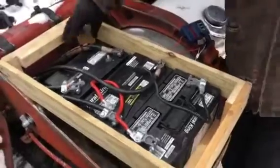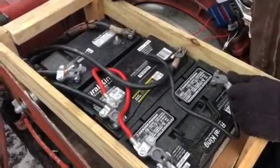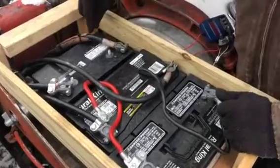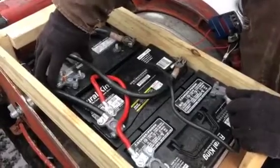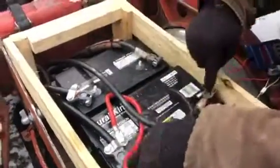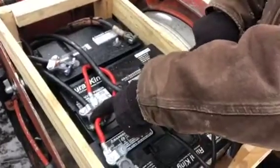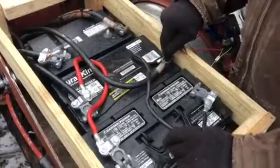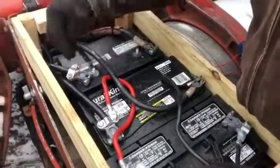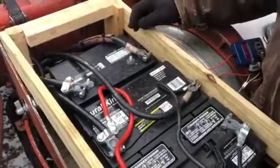This truck here has got two sets of cables, which is kind of unique — it's a Freightliner setup. One set goes to the starter directly, and then the other set comes back up to charge the batteries off the solenoid. Why it's set up that way I don't know. So it was very difficult to figure out how to set this up because you have a lot of heavy cablage going down into that shutoff switch.